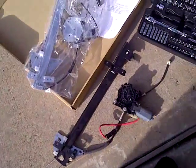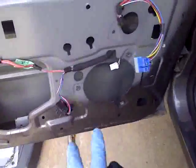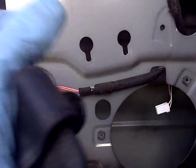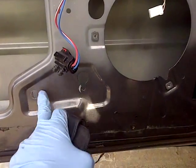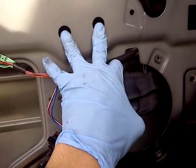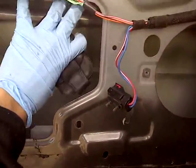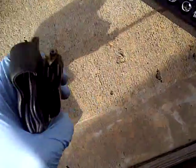Alright, I'm back. Here it is — here's the old one and that's the new one. Basically unbolted the motor. The remaining pieces — it's kind of nice to have a little slit so you don't have to just loosen it and pull it out. It was bolted here and here. It came out and had to come out through here — turned it sideways. There it is, and that's the problem right there: the cable broke.